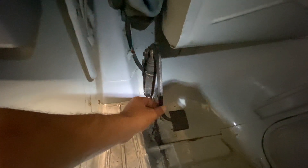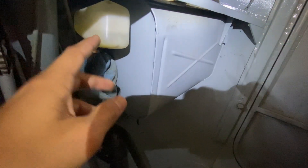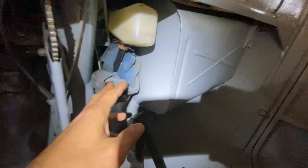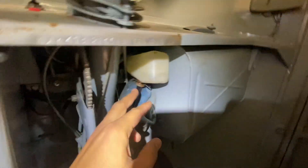Looks like they put on a different master cylinder, which has actually been leaking this whole time it's been here. There's fluid in it — it's fine, the brakes work. I bled them, but you might want to check in with the guys that you bought this from. I've just been keeping a rag up here to catch all the drips because this stuff is pretty corrosive to paint.